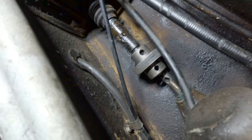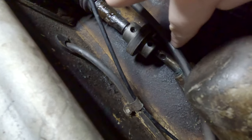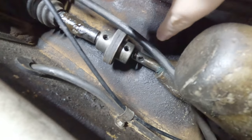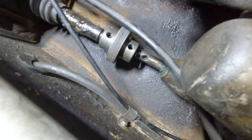Fortunately, when I got under the car I could see the problem right away. This is your shift shaft right here, and this is a little coupler — that's the shaft going into the transmission right there. The bolt that attaches the coupler to the transmission shaft had fallen out.